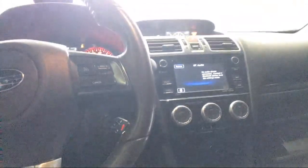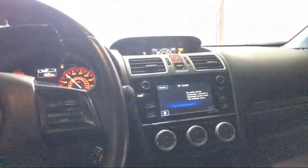So, all right, we're going to do another one at the 130 with the temperature probe on top of the manifold, properly fixed. I'm actually going to do 3 of them back to back, unless the ECU starts giving me some other indications that says I should stop doing that. I'll be watching the temperature, it's not getting too high. If it hits 130, I'm going to stop anyways, because there's no reason to do that to this car. All right, here we go. I'm trying to hold it, see if I can do that. This camera's bouncing like crazy, poor thing.